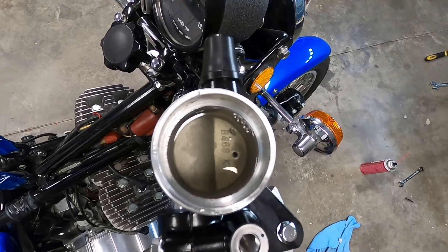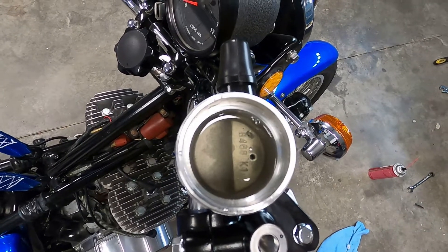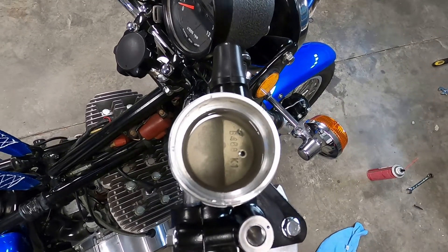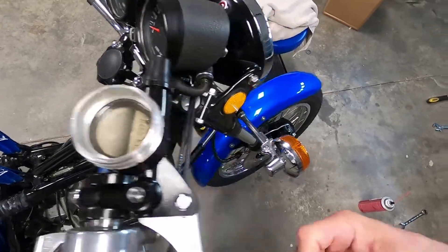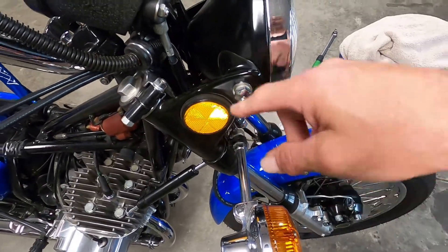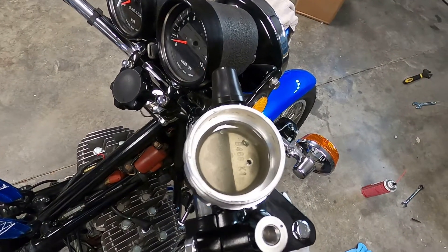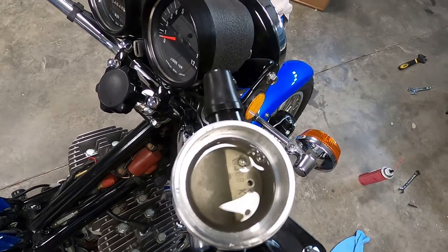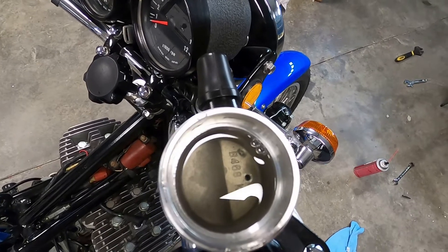I'm still getting air out, so I'm just going to keep doing this until I'm not seeing any air bubbles. Now I've got a brake handle. Technically you could bleed from the bottom, but personally it's easier to get all the air out of this top line first, then bleed the bottom. Most likely what will happen is everything from the new splitter down there is going to settle overnight and come up this way. If you let it sit for a night, put your lid on so nothing gets in the master cylinder. No matter what, you're probably going to have to bleed the bottom. I would never put it back together without bleeding the bottoms.